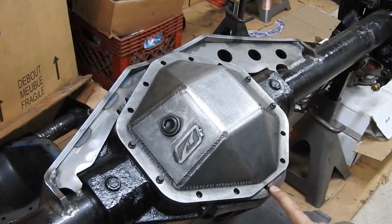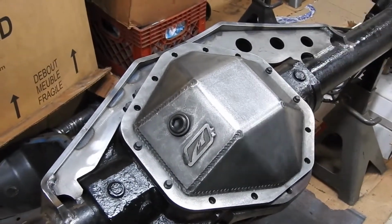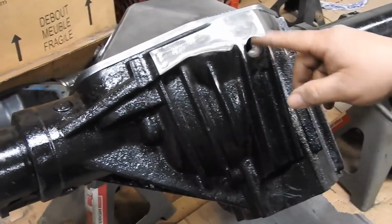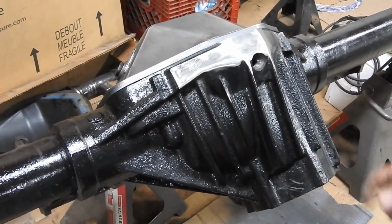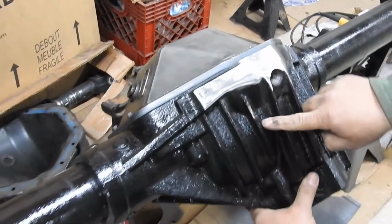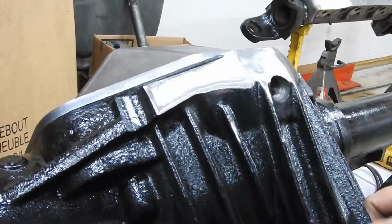We do our mark, run some stencil, scratch it, then decide to look and see what could be affected in there, because the draining plug is in that portion. The Motobilt website says that they recommend to weld or plug weld the drain. Well, yes, probably a good idea, but if I can avoid that, I will avoid it. Then that's when we started looking at measurements, seeing that the axle has a reinforced casting in here. Well, that means that something inside could be different.